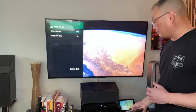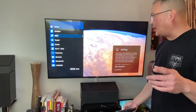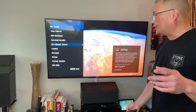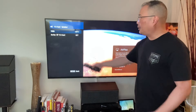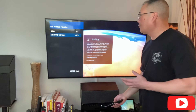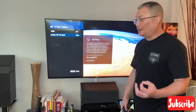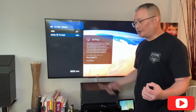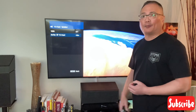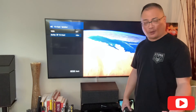Press Option again to go back, then go to Settings. One other thing that came out probably around 1.35 — go to Virtual Speaker, and you'll see these options became available. There's Dolby Speaker Virtual — I do turn it on and I like it. It really is virtualizing Dolby Atmos, which some people call 'Dolby Fakemost,' but it makes a difference. Play around with it depending on your configuration. I helped a friend with only a 3.1 soundbar system and it made a difference. I use Yamaha Atmos ceiling bounce speakers with a decent-size normal ceiling, so it actually works for me.